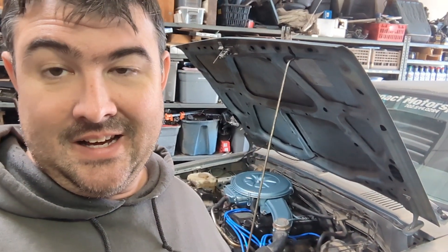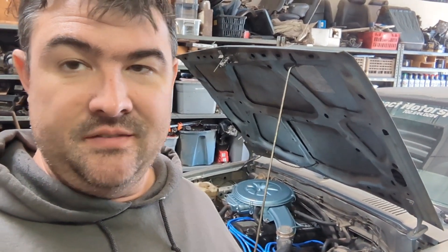In one of our most recent videos, Dave's truck got a new engine. We decided we wanted to make it a smog-legal Weber carb swap. That means we're going to retain as many of the emissions control devices as we possibly can — basically all of the auxiliary emission control devices. So everything on the label is still present on this truck, but we are running a Weber carburetor.